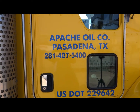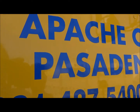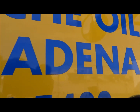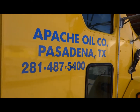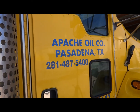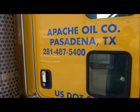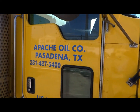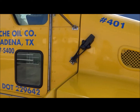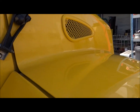Look at that finish now. You have to clay it to remove the overspray off of it first, and then you buff it - no compounds, no solvents, no wet sanding, no high-speed buffer. My buffer stays on 1000 RPMs virtually at all times, even when I'm polishing aluminum.